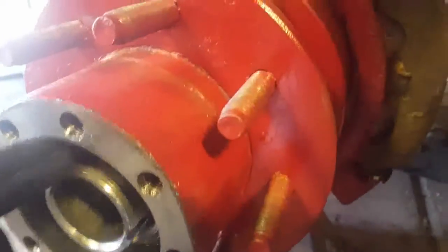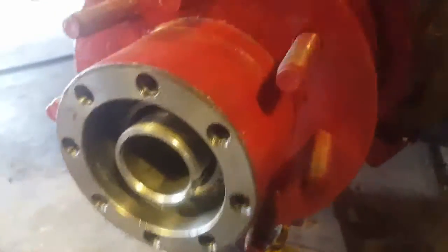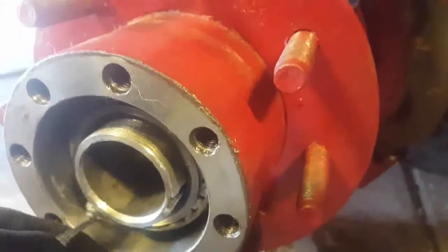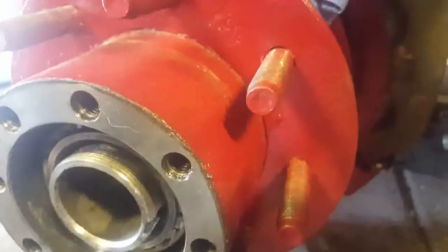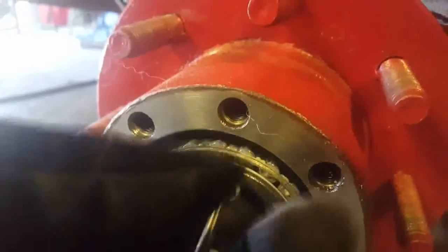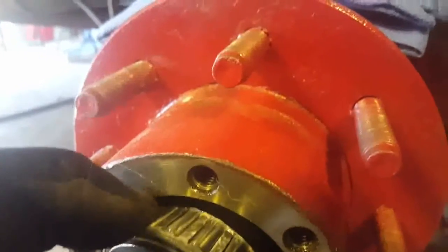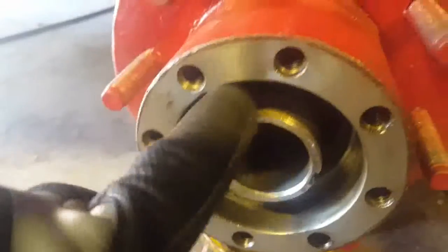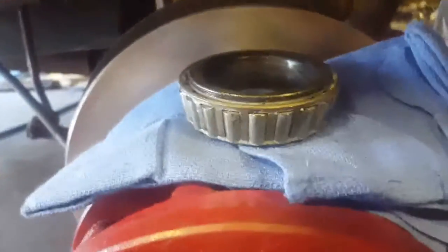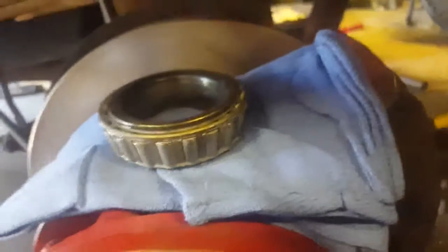Okay, so after you pull the old lock nut out, you've got to get your outer bearing race out. This is your outer bearing race. This is actually the inner race for the outer bearing. Pull that out with a magnet. Keep it clean. You don't have to re-grease these. This is not a greasable spindle or bearings. These are oil bath, so keep your bearing as it is. You'll want to soak that in some oil before you assemble it.